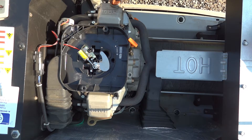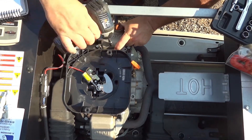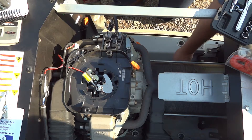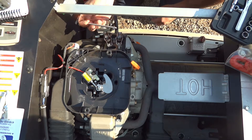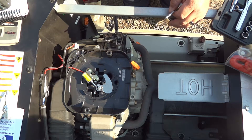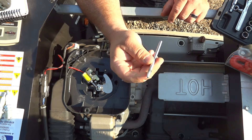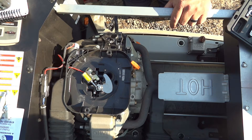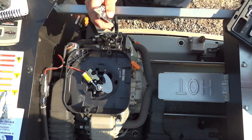I didn't bring my metric sockets over, so I went and grabbed them. Removed the last screw and took off the cover to get down to the lifters. Wow — I wonder why. Right there — there's a rod ripped off. Check it out — somehow it looks like it just stretched until it snapped. Right here is a piece of aluminum, and there's the other piece.